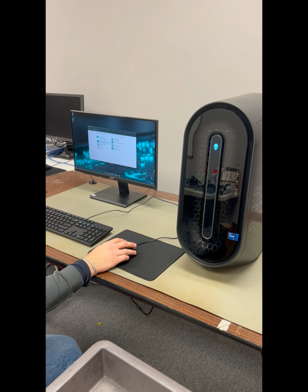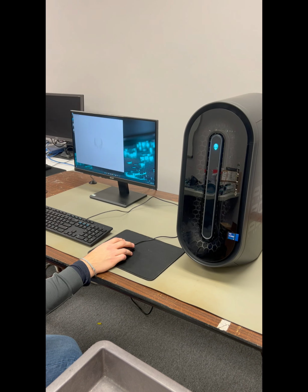Just a personal preference, but definitely something to not forget. One of the first things I always do when setting up a new PC is changing the power settings in the control panel from balanced to high performance, and setting up my screen timeout to get the best life from my monitors without getting annoyed from my screen going dark too often.